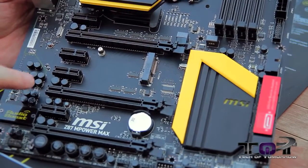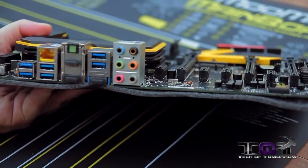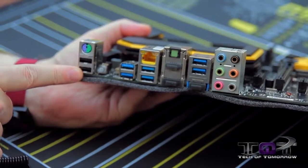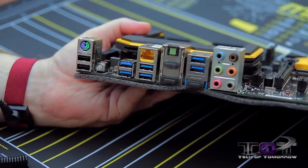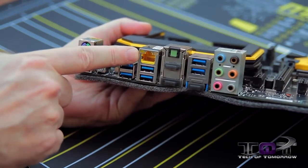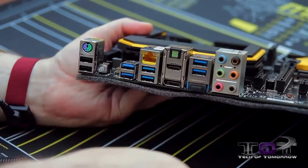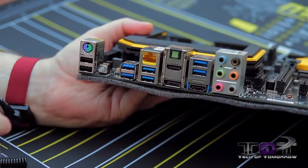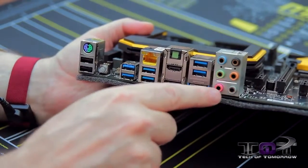You can also tell down here by the audio that all the components are very high quality. And last but not least, let's turn around and take a look at the rear I/O. The rear I/O on this board features legacy PS2 keyboard and mouse. We also have two USB 2.0 ports and the clear CMOS switch — so if this thing's inside your case, you can click this little button and it automatically clears the CMOS for you. Over here we have two USB 3.0 ports and another two USB ports. Up above that we have the Killer NIC LAN. Then we have display port, HDMI, digital audio, and another HDMI port — so this board actually has two HDMI ports and a display port, but no DVI. Then we have two more USB 3.0 ports and all of the gold-plated 7.1 analog audio.